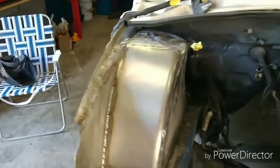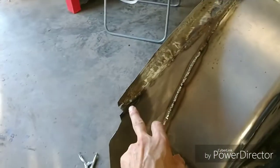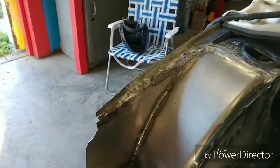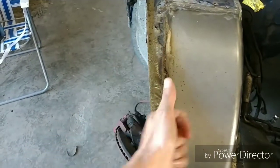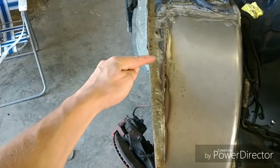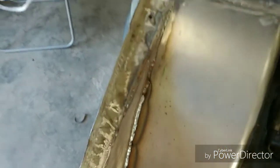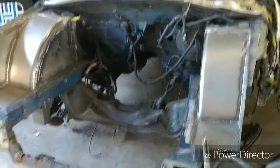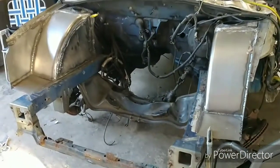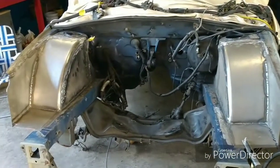Everything lines up because you guys want the fenders to line up nice and perfect. This car was in an accident, so you can see a lot of the damage — which is the main reason I went all the way to the top of the actual fender mount itself to repair this the correct way. You can see right here it's arced a little this way, curves here, then straight back down. I ended up fixing that with the inside weld, then metal finishing it so there's a nice edge again and everything is even, just like the other side. What's great about Subarus is symmetry — one side is exactly like the other. I call them Lego cars. It just takes a little bit of time and planning to address the situation the right way.